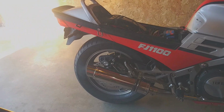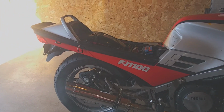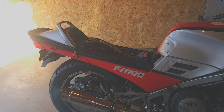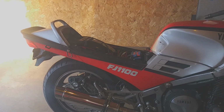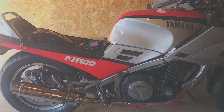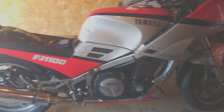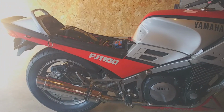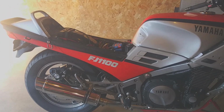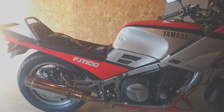And originally, when Yamaha built these, they had a lot of emissions regulations that really restricted them, almost to the point where, if you got a little too lean, you went into the mountains, you could wear out your engine early because you were running so lean. So, although I still run 93 octane all the time in this, with it being richer, you have a little bit more of a cushion for detonation, like heat pre-ignition and stuff like that. So a lot of the heat-related things.